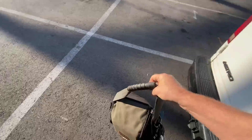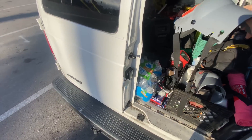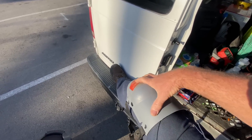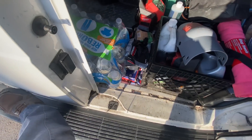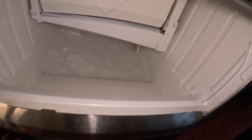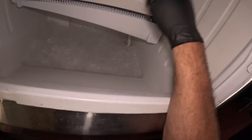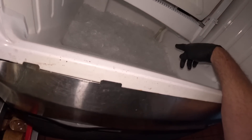Let's see how we make out today. Ice maker - we'll be on the ground, get some knee pads going, get some rubber gloves, and get in there. Let me move this out of the way. A little defrosting going on. Yeah, they're at the end of their ice. The sump looks like it's in. Oh, the drain line's pinched back there - I can see that, I can see where it's got a little pinch in it.